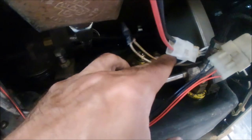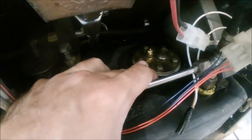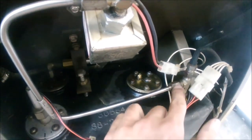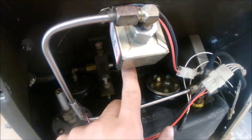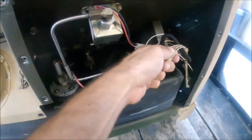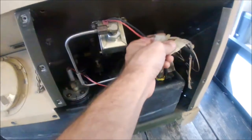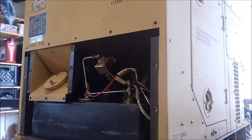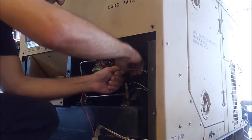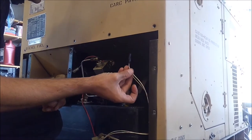When you take off that rear panel, you'll see the fuel level sending unit - that's what you're going to replace. It's got five Phillips head screws. There's also a fuel line coming from your auxiliary pump over here. Use a crescent wrench to take it off. It also won't hurt to disconnect the fitting for your auxiliary pump, your low-level shutoff, and the auxiliary pump wires just to get them out of the way.